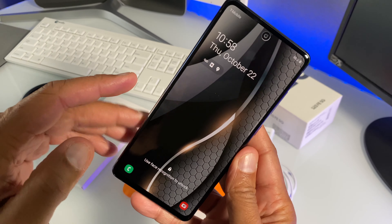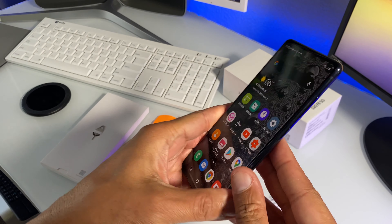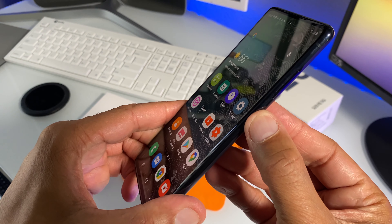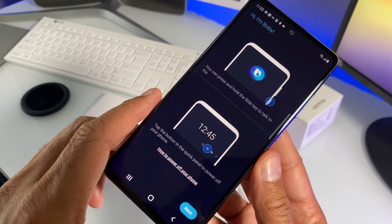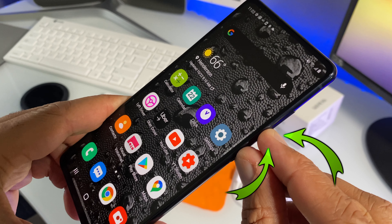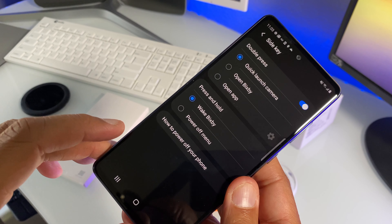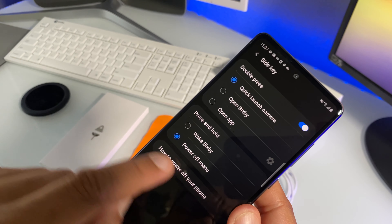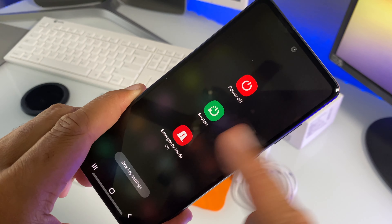You already know how to power the phone on, but do you know how to turn it off? That's the biggest question on some of these smartphones. There's a side button on the right side — that's the power button. Initially when you press and hold it, the only thing you'll see is something coming up that says 'Hi, I'm Bixby.' You do have several options to power this thing off. You can hold the power button and the lower volume button and it will go to the power off screen. Notice at the very bottom it says 'side key settings' — press that. Now you're in a menu where you can assign what you want the side buttons to do. I want to see the power off menu when I press and hold the side power button. Now when I press and hold, it goes right to my power off menu — it does not go to Bixby anymore.